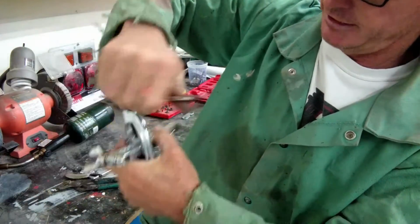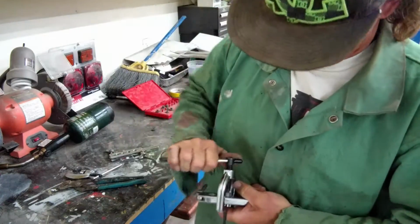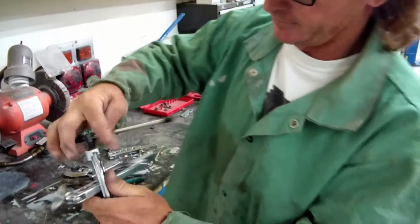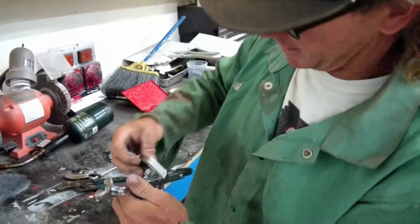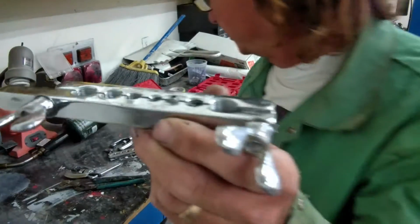And we're going to go ahead and tighten that dude all the way down. Nice and tight. You're not going to over tighten it unless you put too much line on there. If at the end it all looks silly and bulky, it's because you put way too much tubing sticking out there. 1/8 inch is more than enough. So we're going to pull that bubble flaring tool back off. You barely even see just the slightest little bubble. It's barely even noticeable. It's just enough.